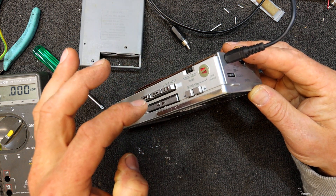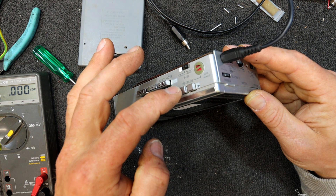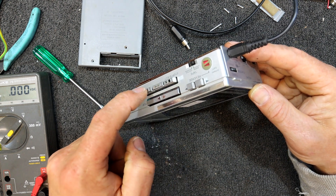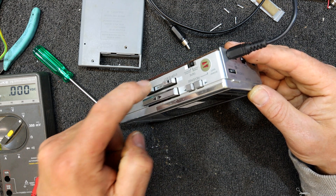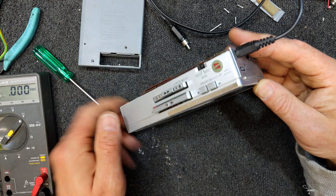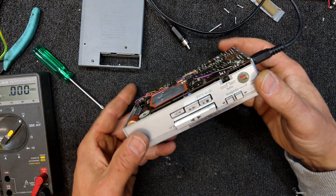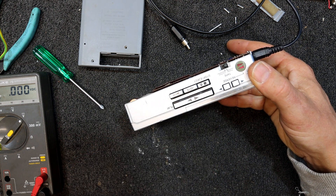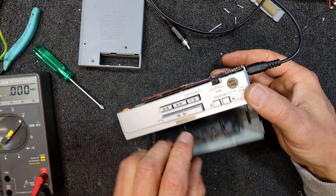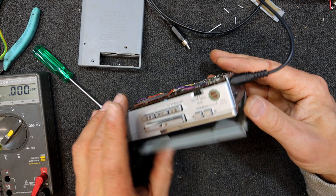Doesn't hold the end of the tape. It's a bit slow when it's getting all that in there, almost stopping. I'd say the belt's probably not as good. Are there actually two belts in there? You can see the belt wobbling around — that's not usually a good sign. That's very wow-y. That ejects when it's — that may be just my lead, but it's probably the headphone socket.